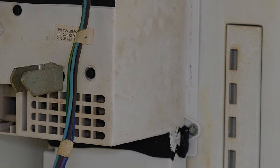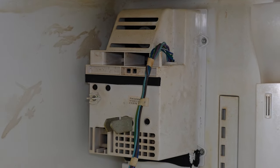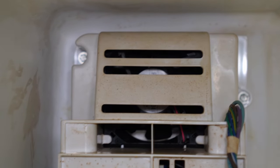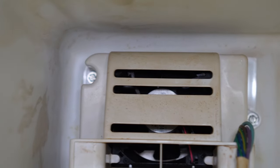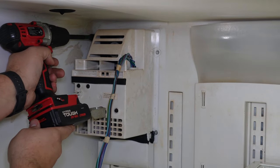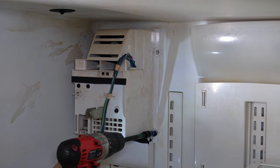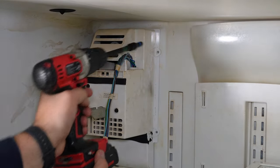In the case of my Frigidaire refrigerator, the air handler doesn't look in very good shape. To get to the culprit of most problems on this ice maker, we need to remove three screws from this housing. The quarter-inch screw in the upper left corner is by far the worst screw on this refrigerator — you have very little room and will want a very long 12-inch extension on a screwdriver or drill gun. This screw loves to fall away when removed, so be very careful. The other two screws on the right are far easier; they're all quarter-inch.